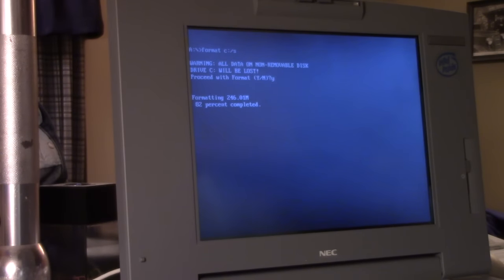So if they were mishandled while in operation, there's a very good chance that the heads could crash, that is, contact the disk surface, and cause physical damage to the platters. I explained to this individual that you need to be really careful, because it doesn't take much to wipe out a drive. I don't know how that ever turned out. I was able to format the drive. I knew how the drive was damaged, so I wasn't concerned. I formatted it, reinstalled the OS, and everything was good.